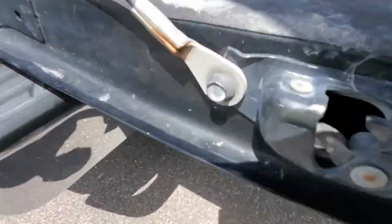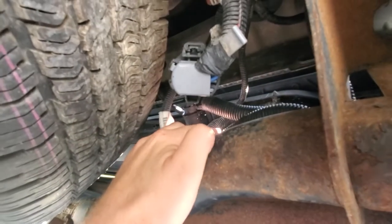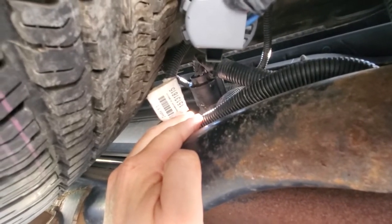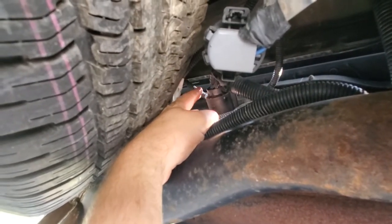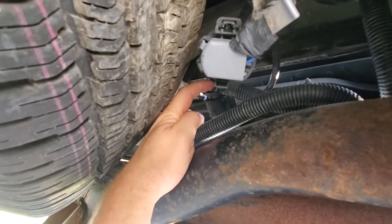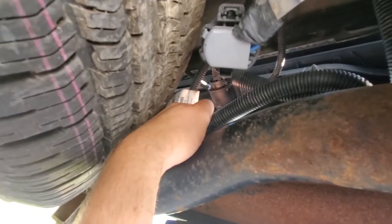There were two things I found. Under the truck where the wiring harness is, I've got a light socket up in the bed of the truck and then a light socket in the back on the bumper. Nothing was working — I hooked it up to my cargo trailer and that wasn't working, and the one in the bed of my truck wasn't working either. What I found was that this socket had actually come out. It's just clipped on and plugs into the socket out on the bumper — it had come completely off. So I put some contact cleaner in it, cleaned it up good, and slipped it back on. That was one problem.